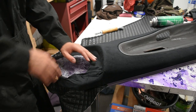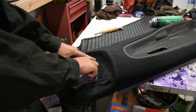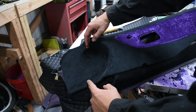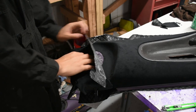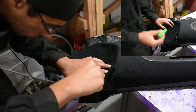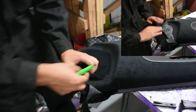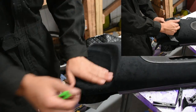I cut out this section right here. This material really isn't that stretchy, so this section I'm actually going to cut a different piece of fabric and put that in right here and line it up perfectly. In the end, I'll get something where it's all cut out and new pieces laid on top — that way the majority of this is all straight and no wrinkles, compared to something like this where it's a complete mess. I have this spare piece of fabric that I'm going to section in, kept in place with clothespins, and I'll just run my razor along the edge of wherever I want it cut, then apply adhesive so it lines up perfectly.